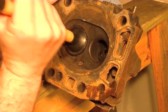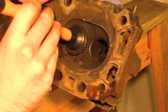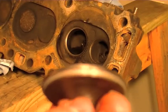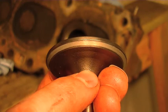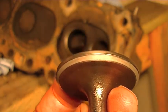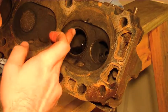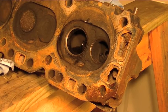You want to give it a kind of pop — that spreads out the valve lapping compound. You can see here on the face where it's kind of shiny, and then that dull area is what we've just ground down. We've got a little bit more lapping to do, but we're getting pretty close. This intake valve wasn't leaking badly on the leak-down test, but it was a noticeable leak. I can see there's really not a lot of pitting on the valve seat, but I still need to lap these a little bit more with the coarse grit and then move on to the fine grit.